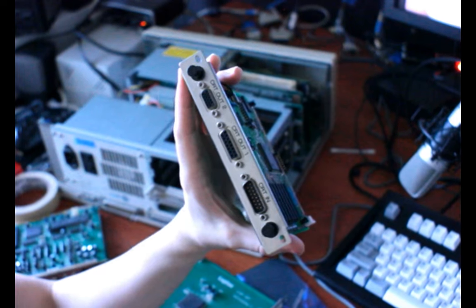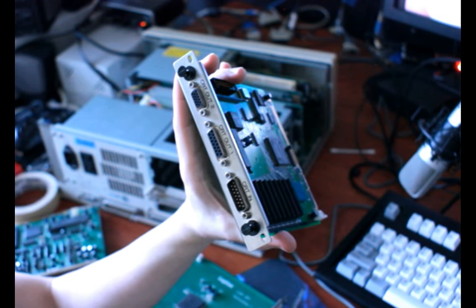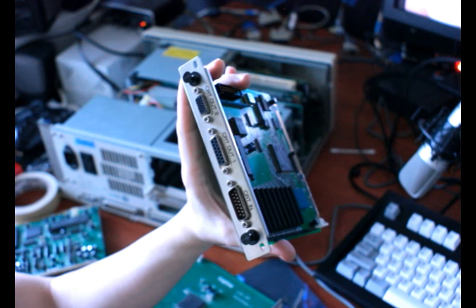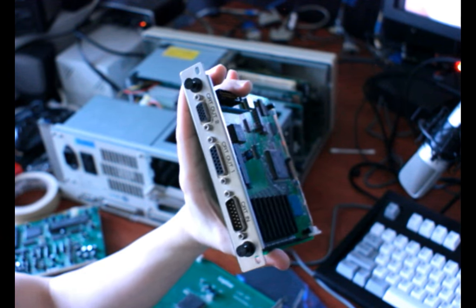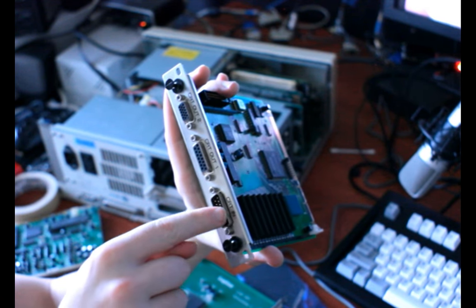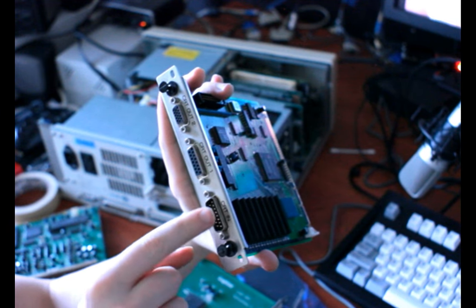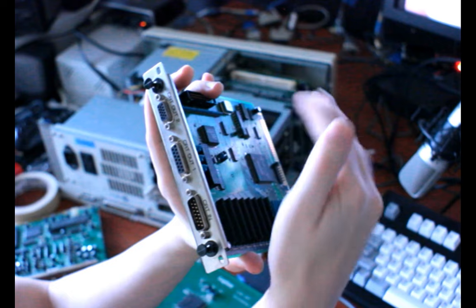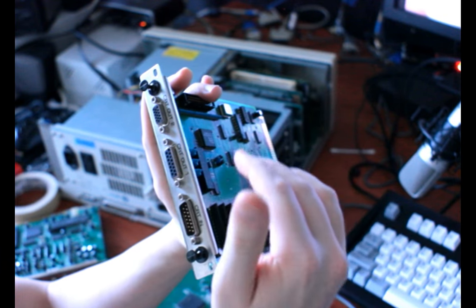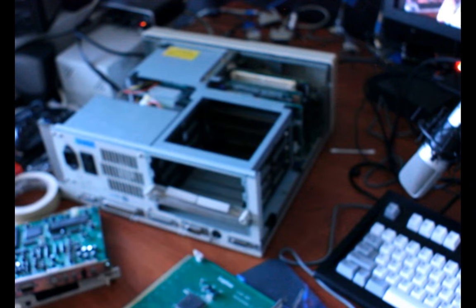But yeah, so this is a cool card. Also, you need to do pass-through on it. If you've ever had a Voodoo 2 graphics card, you might understand what that means. Basically, you have a two-dimensional graphics card that outputs a two-dimensional rendered image, and then you feed it out of there and into this connector, or the CRT in connector. Then from there, you can overlay whatever's being rendered on this card on the picture and send it out to your display. So I just think that's kind of cool.